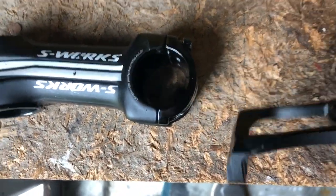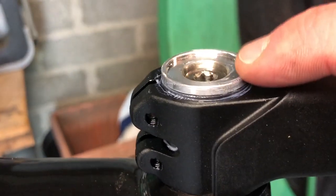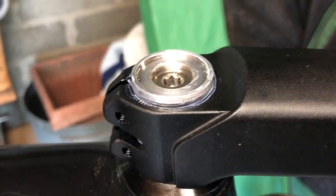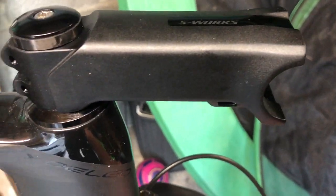Let's go and put it on the bike. We've taken off my old S-Works stem — this is the out-front computer mount, a 100mm at minus 4 degrees. We've put the Venge one on, but we can see we've got a little bit sticking out the top. I can either find a cover or just put a 5mm spacer on there and put on the stem cap. For now, since I don't have the cover, I'm going to use the 5mm spacer with the original stem cap. Next, we're going to attach the handlebars onto here and try to thread the cables through this little clip.